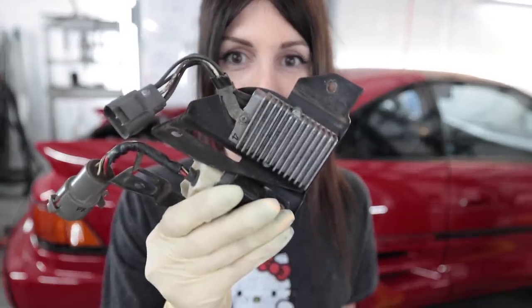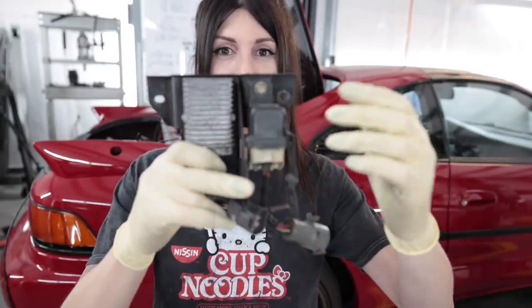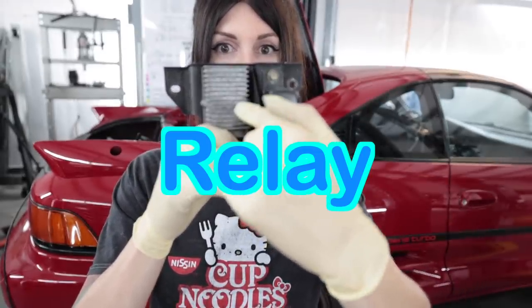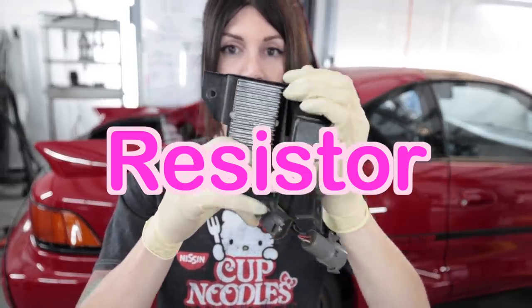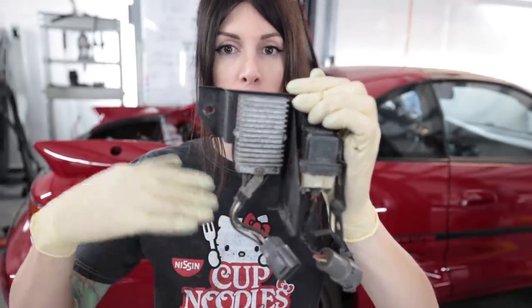You see this right here? Oh, it's about to get confusing. So this is a fuel pump relay, this is a fuel pump resistor, and this is trash — I don't need it. The MR2 from the factory had a variable speed fuel pump: it would pump harder when needed and go down to a lower speed when not needed. It's pointless.